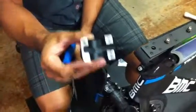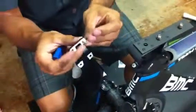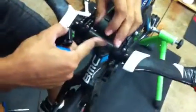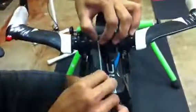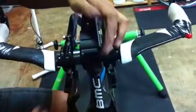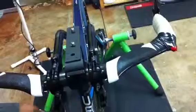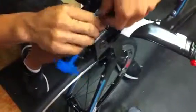If you could, send us back the old ones — these were taken off one of our bikes. You can pick any of the random M4s. I'm lucky I don't have a bunch of wires running through this, it might be a bit more difficult for you. But the basic idea at this point is just reassemble: face plate on, putting the four-mil bolts in first. The way I've built this clamp, everything should line up, and the next three bolts should be relatively easy once you've got the first one in.